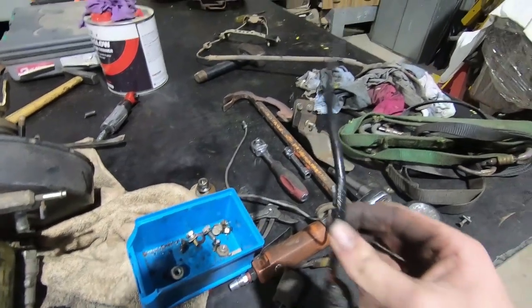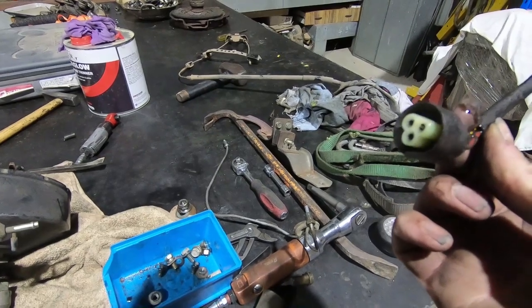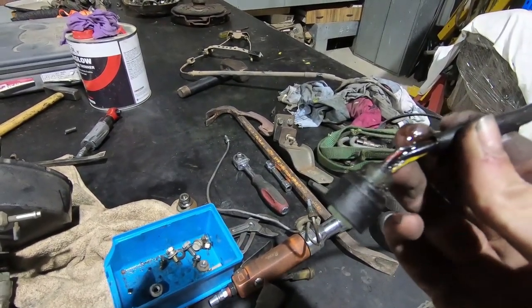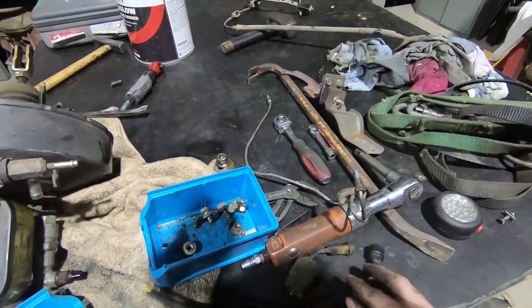Also grabbed the plug off the gearbox loom because my gearbox loom doesn't have this plug on it. It's missing from when I did the 25 box conversion. For anyone that's done that, there's actually a 2-wire speed sensor, not a 3-wire, so I removed that then.